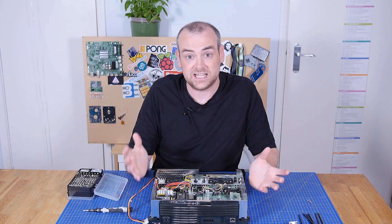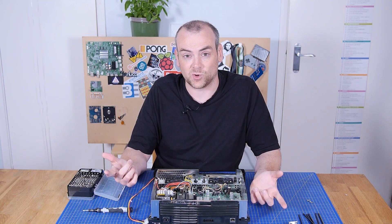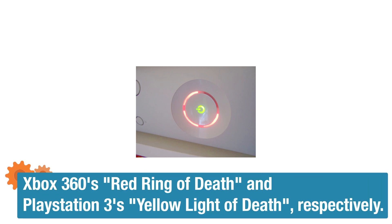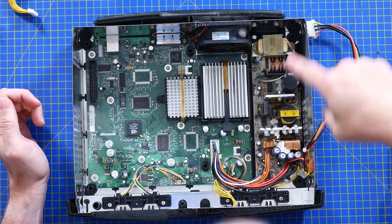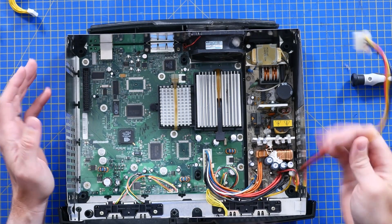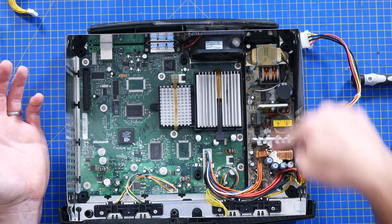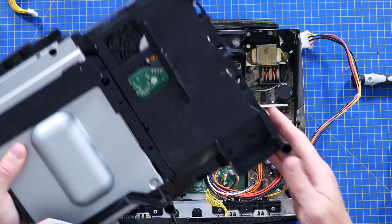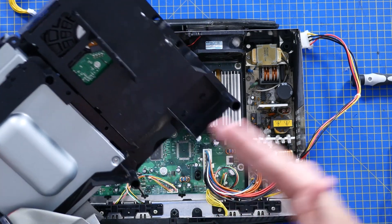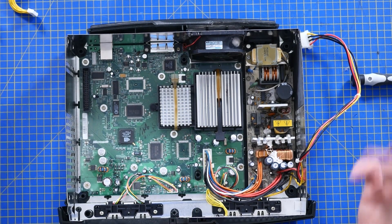So you didn't have to have enormous heatsinks, and yet the PlayStation 3 and Xbox 360 both still had overheating problems — was it the three lights of death? And the PlayStation 3 had like a flashing ring of death or something? Interesting that the power supply is a bare board in here. I'd still expected it to be in some sort of can. This is a switch mode power supply, all high frequency noisy stuff, and there's no shielding to prevent noise being emitted to the motherboard. That seems like a strange choice to me, but I'm sure it worked.